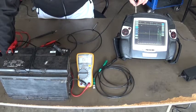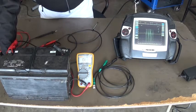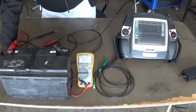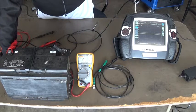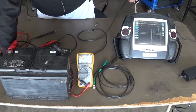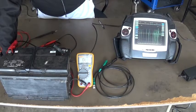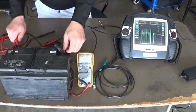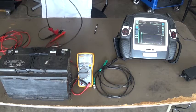Look at that. I was driving a car and had my current clamp on — I think it was a fuel pump or something like that. As I was driving I could see all these dropouts in the current. Basically it was that bad lead that was messing me up. So let's put a good lead on it and see what that is supposed to look like. That is one thing that can happen with these BNC leads and it is very common.